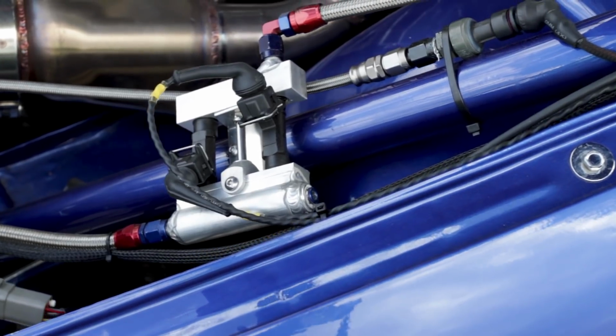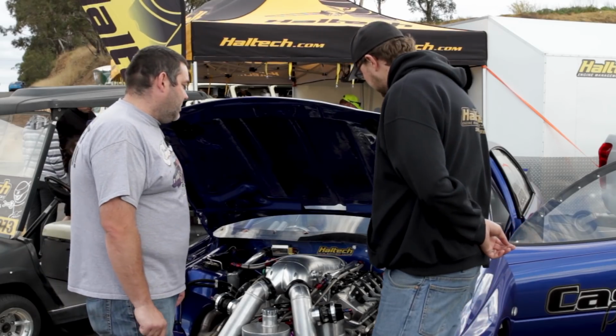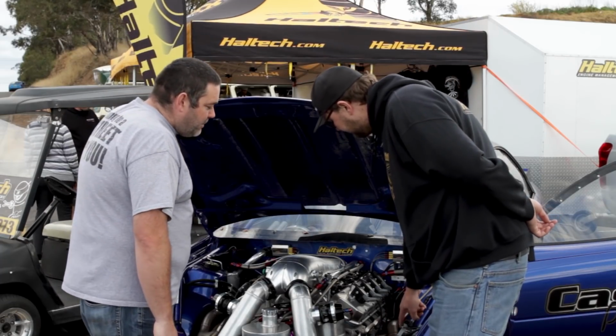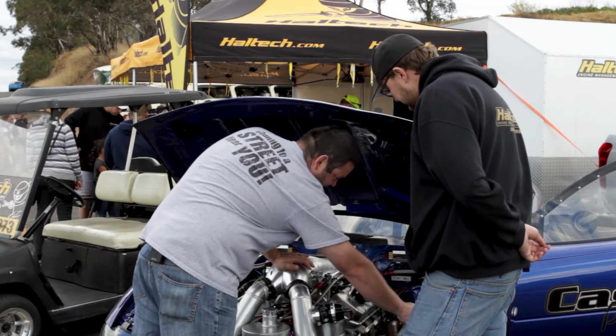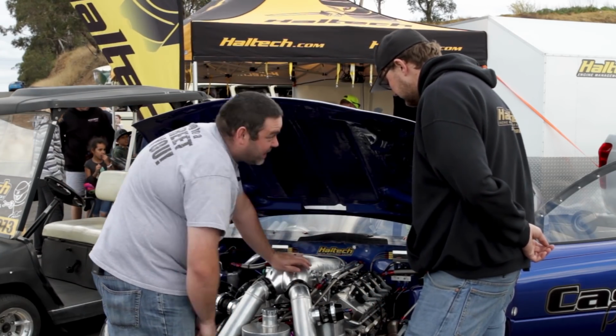And there's a pressure line here, so is this manifold pressure or CO2? No, it's CO2. Right, so what's it actually controlling? So CO2 comes in through this manifold, I guess you'd call it. The CO2 comes in that line there, and then straight through that injector there, and then that goes down to the wastegates. And if it goes over pressure, that one just dumps the excess back out.